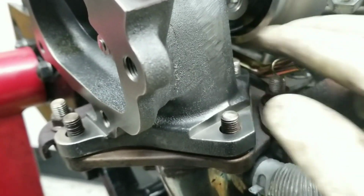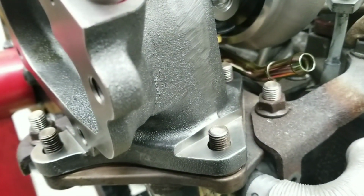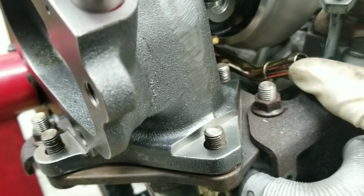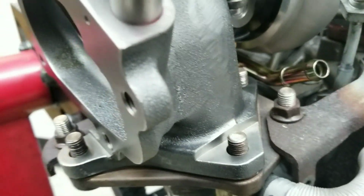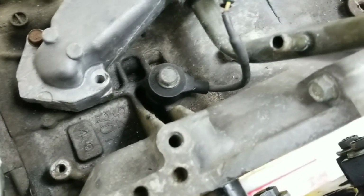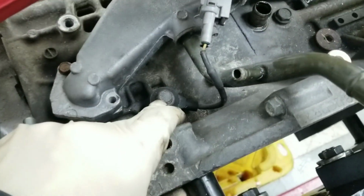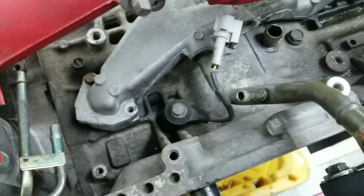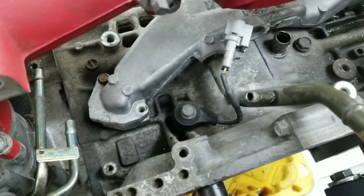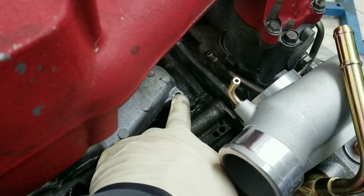Whenever you have two metal objects touching that aren't securely fastened together, that have any potential for vibration of metal on metal, what happens is your knock sensor, which is hanging out over here on these Subarus, starts picking up that noise, and it says, oh, there is something going on. And when it thinks there's something going on, it starts to pull ignition timing out. Missing a few bolts. This one is actually stripped out. I'm going to have to helicoil that or something.